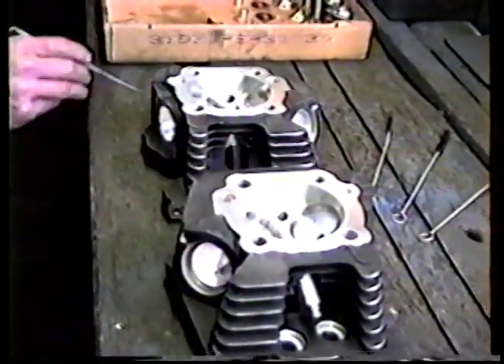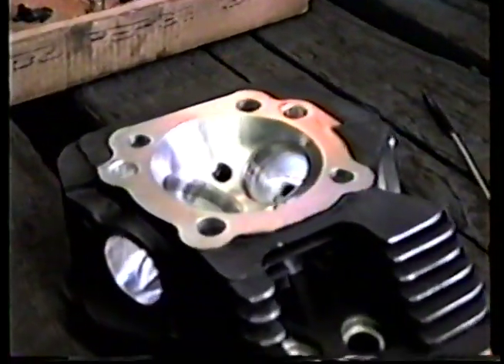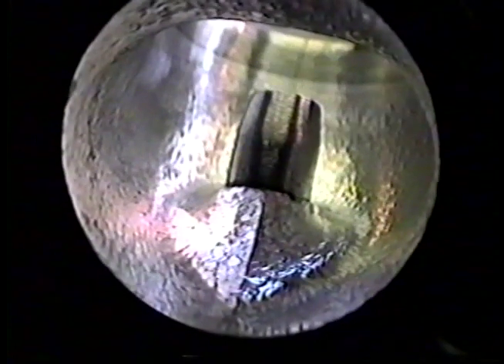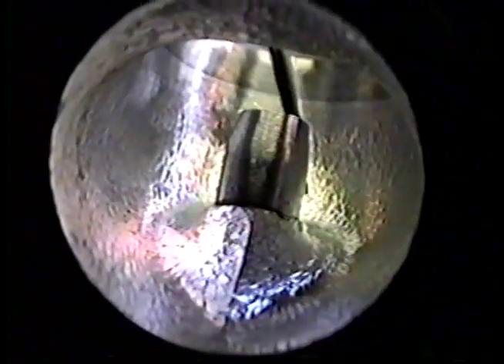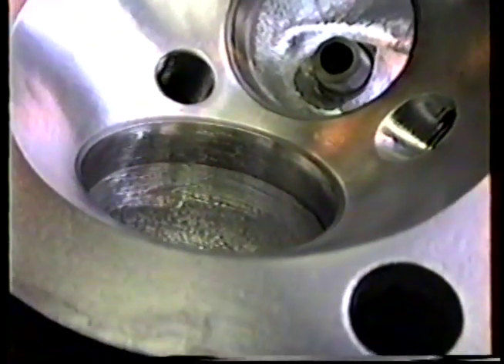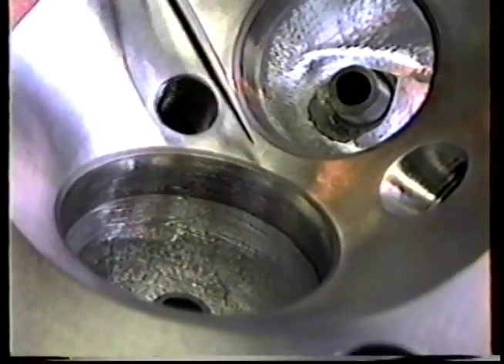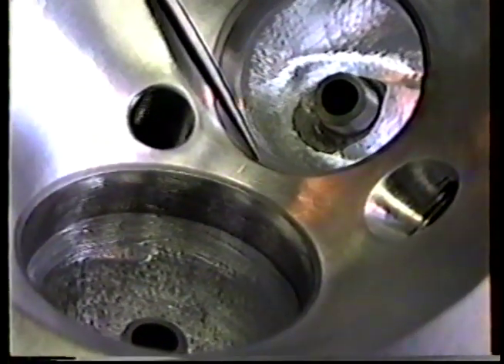This is the rear head over here — you can take a look through the ports on this one. This is the approach shot to the intake port again; we're pointing at the tool finish. We taper the tool finish up from here, start with the polish right about there, come up here, and start to roll over onto the seat. As you're looking at it again: 45 thousandths wide on the intake, 60 thousandths wide on the exhaust.